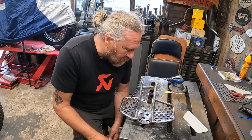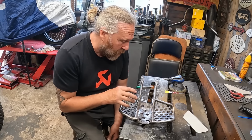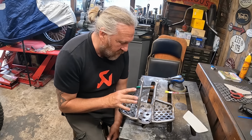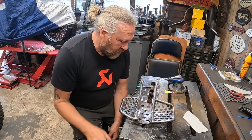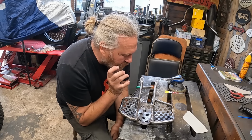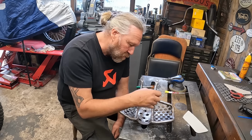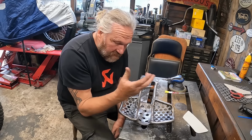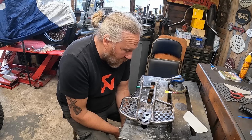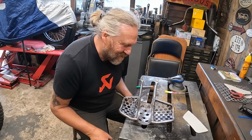The weld looks absolutely awful. I think if you close one eye and pour bleach in your open eye, it might look okay. But as I'm looking at it now, it looks terrible. Not a lot I can do about that, unfortunately. Even if I've got this blasted, I guarantee that all the inside of this tube is rusty, and if your weld's penetrating into the tube, it'll still fizz up. I've had it before, you get really old stuff blasted, you think it's fine, you weld it and it looks absolutely awful. But hey, it's stuck. That's all I can say about it.